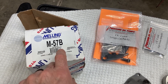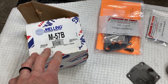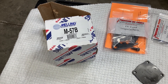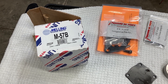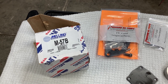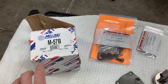The high volume pumps tend to take a little more horsepower to spin. In this engine we're building, we're picking up those little incremental bits of horsepower wherever we can. The majority of your horsepower comes from your cylinder heads, camshaft, and compression ratio — and then you can start adding little incremental bits. Things like pulling vacuum on the crankcase, cam tunnels, reducing windage, and reducing losses from turning a big oil pump.